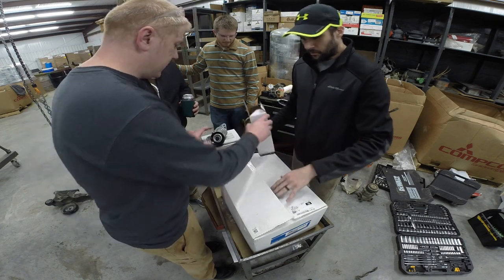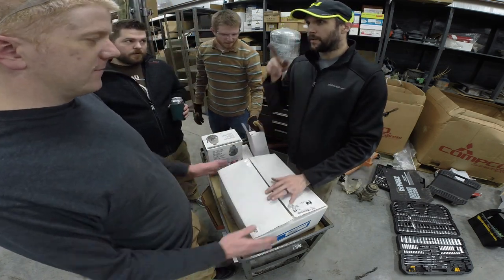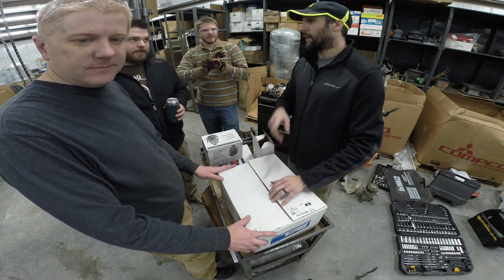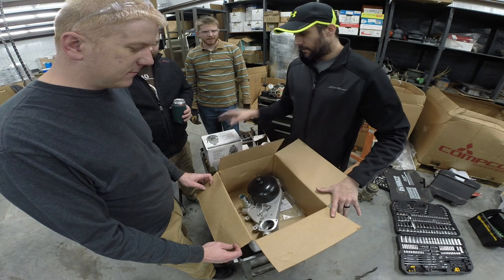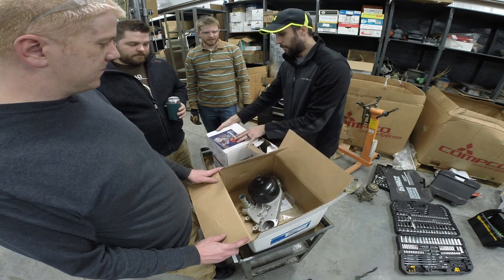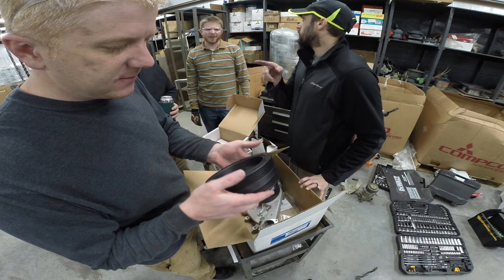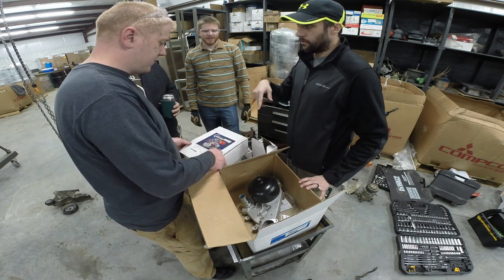Both same. Okay. Now this is the mod, because you can either use an LS3 water pump with the truck harmonic balancer for $350. Wow. Or you could get an LS1 water pump for $139 with the 97 Corvette harmonic balancer. So we have a new balancer. Look at that, and LS1 pump. 97 Corvette harmonic balancer for, I didn't realize that was a harmonic balancer, $210 total.